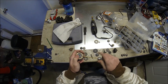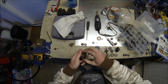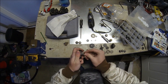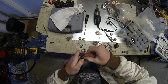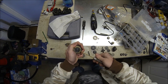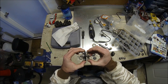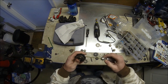In order for this to work, you're going to need these little shims like I said earlier. I'm going to take one out. Slide the bearing back on — it's still rough, so I gotta take another shim out. But you see how first gear moves? That's because I didn't machine — I didn't shave it down far enough.